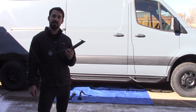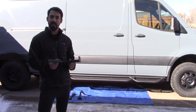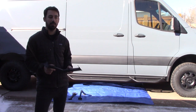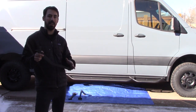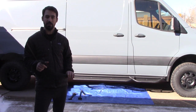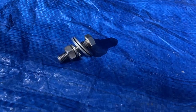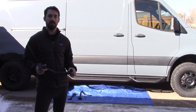Each of the support beams looks slightly different, but it's a similar strategy. You need to rib nut into a no drill zone on the chassis of the van, which some people are concerned about. I've heard some people mention that they don't actually need to. Unfortunately, we did not receive any bolts to go between the support beams and the side steps. We did, however, receive enough of the rib nuts and bolts for those into the body and chassis of the van. So we just went to the hardware store and bought some matching M8 bolts, nuts, locking washers, and washers, to pull it all together.